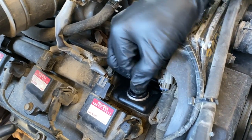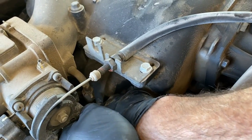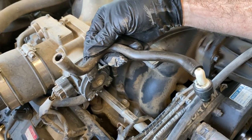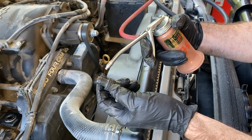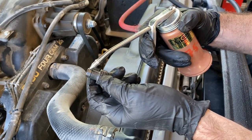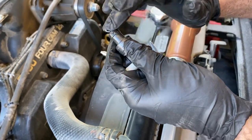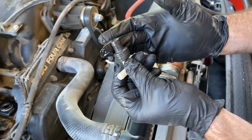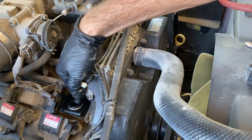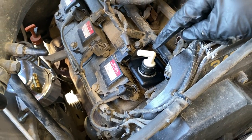This one is still pretty malleable, so I'm just going to wiggle it out — and it popped out just like that, really easy. Because we know these PCV valves are really hard to get out after a lot of time has passed, we recommend putting a little bit of oil on here — engine oil or even a little grease — just a little bit to lubricate it, so hopefully it's going to be much easier to remove down the line. We're going to point the fitting towards the air oil separator because that's the direction of the routing we're going to choose.